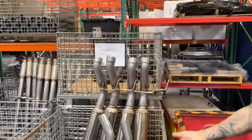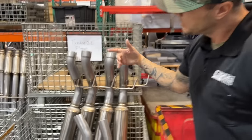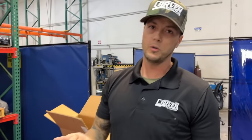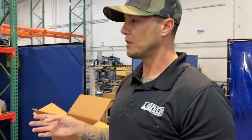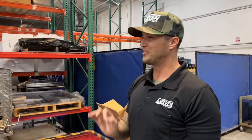With our full cat-back kit, we don't produce a resonator in it. There's no extra resonator in the back near the tailpipe. So we've doubled, almost tripled the size of the muffler to make sure that we have optimum flow. You get the most performance out of that, but you're not dying with drone or anything like that. The cat-back hits a little more aggressive, but I'm anxious to see your reaction to just the cut and clamp, because it's not far off.